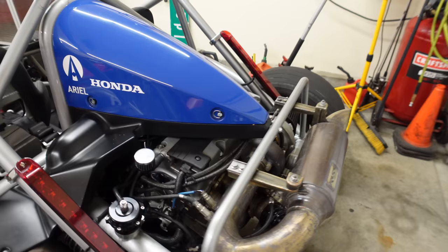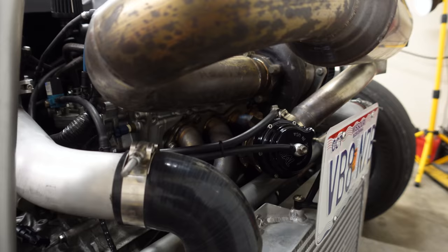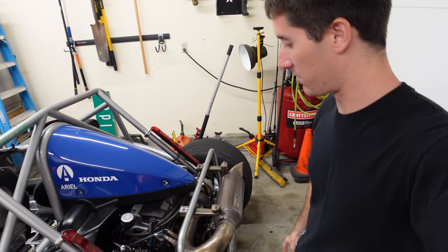We broke it real good. You can see the hole right there — there's a hole and there's more hole. Let's get this thing apart and see just how bad it actually is. PFI Speed fixed a bunch of the welds on the exhaust. Basically, they said none of this was back purged when it was welded together. It's all titanium. You can see it's got a beautiful color that it's changed with a little bit of heat in it.